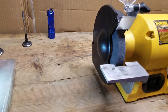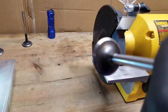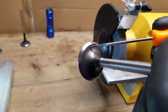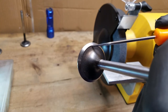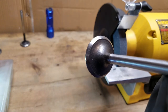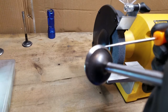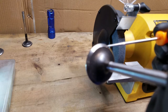Alright, so what we've got going on here is we basically have some stock valves. What we've got here is this big lip going on, and we want to make another cut — we want to take off this lip because the lip can create turbulence, especially knock down your flow at 400 thousandths and below for sure. So we're gonna take out that transition and smooth it from the back side of the valve onto that seat face.